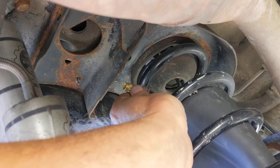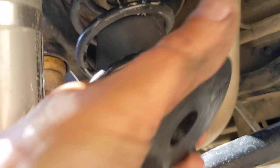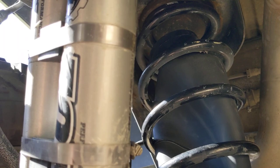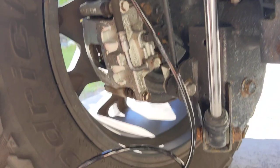Now I have to slide the puck over this so the stem won't get damaged, and that will go up like so. Then I'll put it on the top of the bag, screw it in, and let the bag reinflate essentially. Then I'll route this hose all the way to the back of the vehicle — probably next to the trailer attachment or the wiring harness.